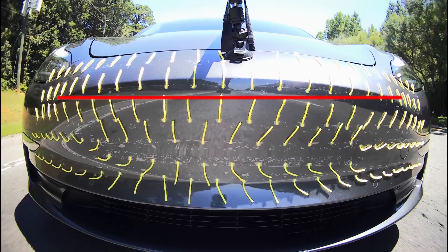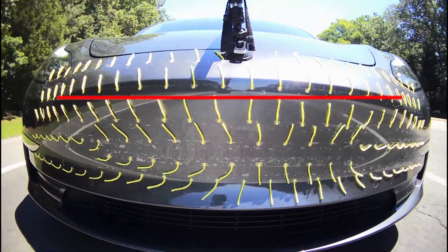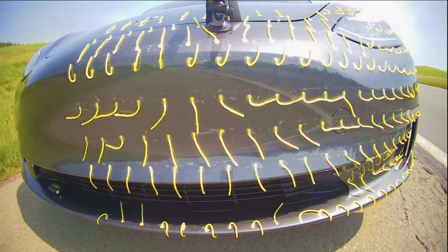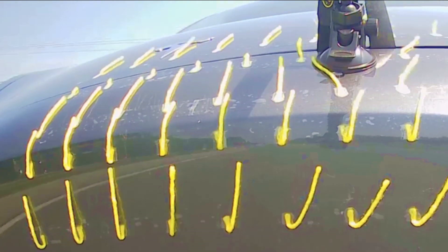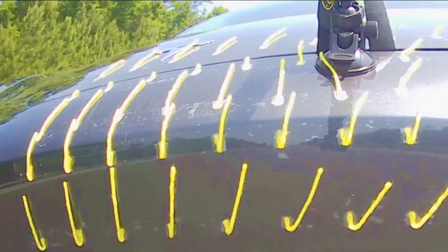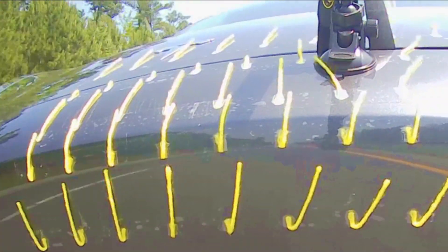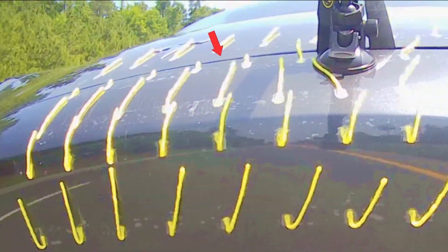At and behind the upper lip, the streamlines are straight back — at least they're laminar, with no separation that I can see. This air must be further compressed up and over the windshield, so that inevitably adds drag to the car. In the center by the Tesla badge, the flow appears smooth and laminar, with the tufts right against the surface. If the airflow were to detach from the surface at any point, this is probably where it would happen as it clears the lip vertically — in an airplane wing, depending on where airflow detachment occurs, this may result in an aerodynamic stall. One of the row of tufts got sucked into the panel gap at the frunk, so there is a little bit of flow into that gap, though I think it's probably small and incidental.